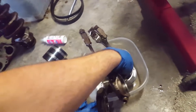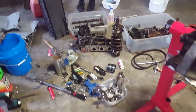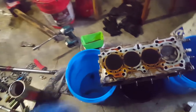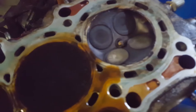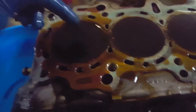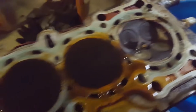Today we are working on this F22 motor — we're doing a full rebuild on it. If you come over to this side, I've got the top of the combustion chamber, the area where the dome of the piston would meet the head, and I've got it being cleaned right now. This is how it looks before the cleaning, and I've got these topped off with the Chem Dip solution. I just sealed it with the spark plugs — you can see I left them in right there.